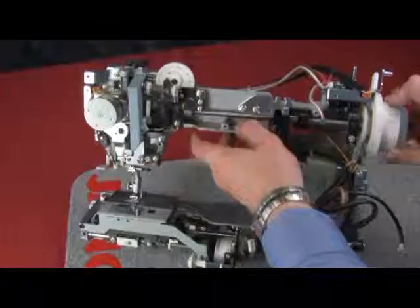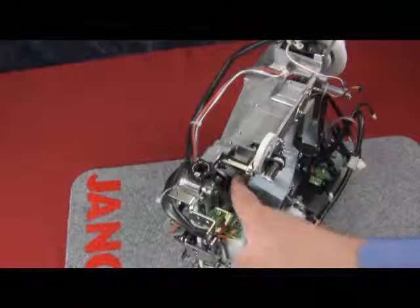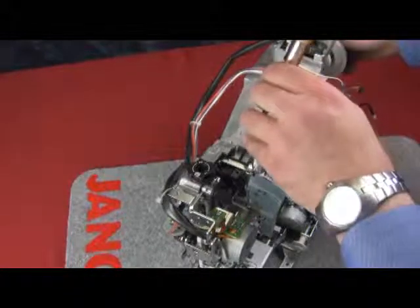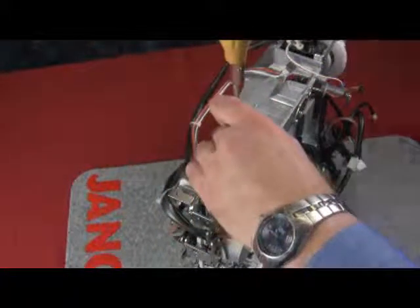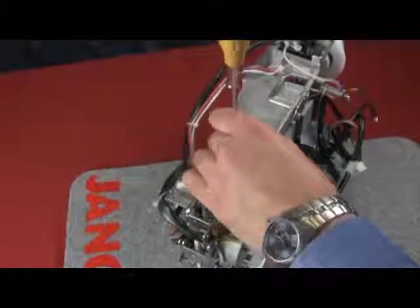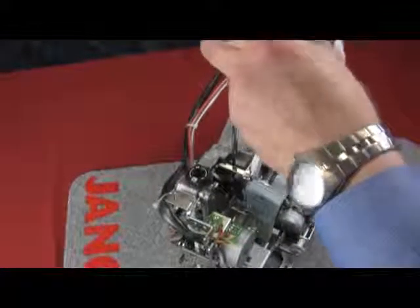The first piece we're going to focus on is the counterweight. On the counterweight, you can see there is a pin on the top. You can use your 3mm hex driver because it is the same size and it acts as a perfect punch. You need to line it up perfectly — make sure it's lined up really nice. Use your hammer and hit down on it hard. What's going to happen is you're going to end up hitting that pin into the bottom casting. Make sure you hit it really hard — you are not going to break the casting.